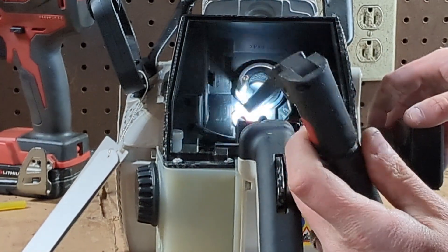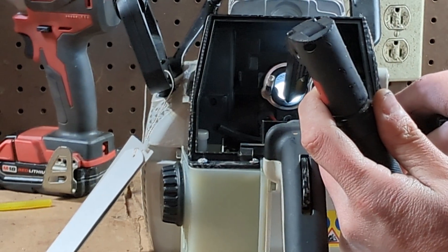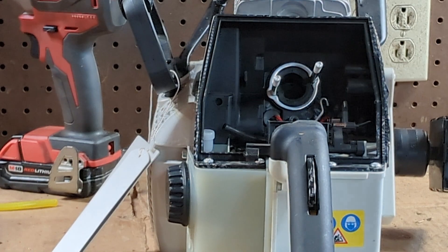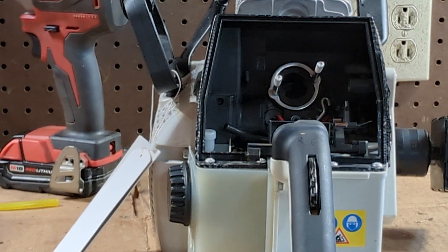So what I will do, shining a light down in here — if I can capture this — I will find right where that piston is starting to open up the intake port on the upstroke. Then I come over here and I zero out my indicator. It says zero. I give it a second to set up.